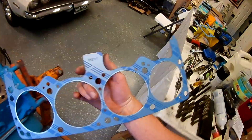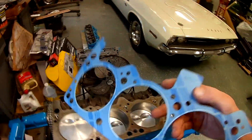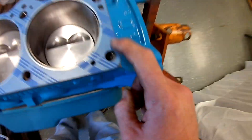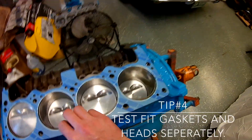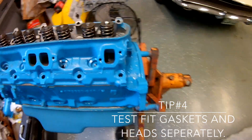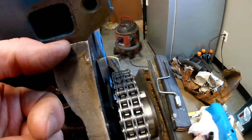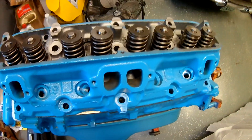These are just the Fel-Pro head gaskets that came in the kit — 8553PT — and they'll only go on one way. Notice that's hitting my dowel pin, so I have to flip it over. Quick tip for you: I went ahead and test fitted the head on the block to be sure it seats perfectly all the way around, there's no big random gap, it's not hanging up for some reason. This head looks good — this is the one I did in my porting series. This is actually a 318 head; there's that casting number 2843675.